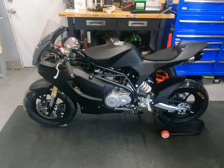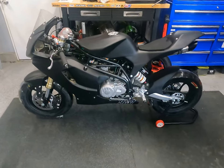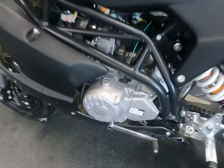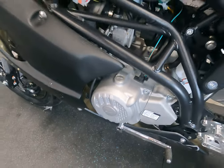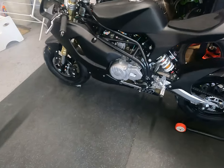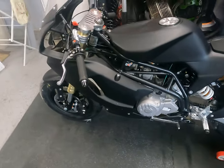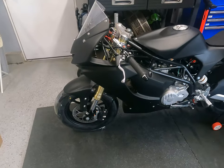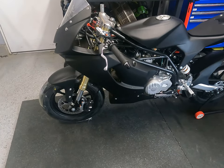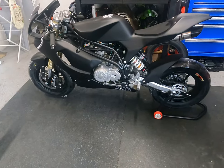I will be doing a few pre-maintenance things before I get this on the track and break it in. For the Zongshen motor: lube the starter chain, check your valve clearances. One thing to look out for is the decompressor or camshaft — sometimes it doesn't spring back. Peter didn't mention that being an issue, so it may be a non-issue, but worth checking. There are a lot of resources out there for the Zongshen, and again the Daytona motor option is available for not that much more — so if you can swing it, I'd go for the four-valve.